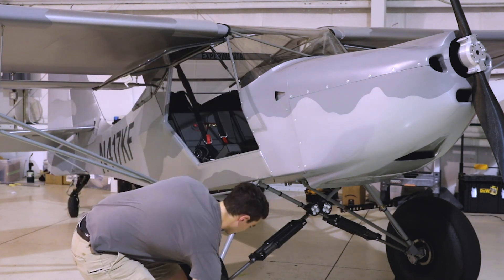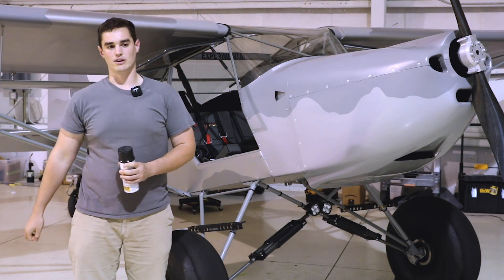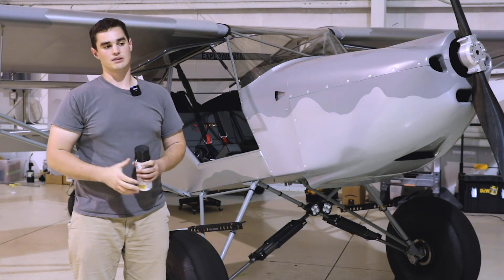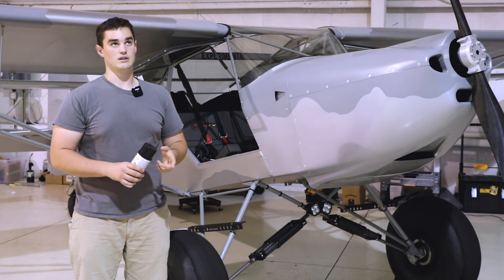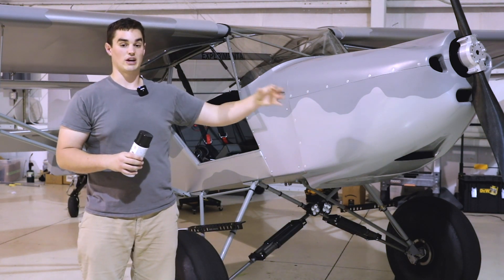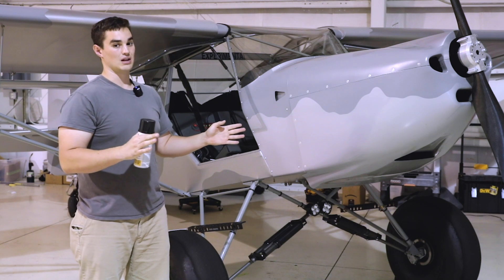The other problem I had was engine cooling on the ground. When I ran it up to high RPM to test the prop settings, then pulled back to idle, it would get hotter and hotter no matter what I did — basically starting to overheat on the ground. I called Dean Vogel at Lockwood Aviation and he said these IS engines — the 915 and 912 IS — have difficulty with ground cooling. I then called Brandon at Kitfox and he said one solution is to open the NACA duct up to 11 inches, so that's what I did — problem solved.